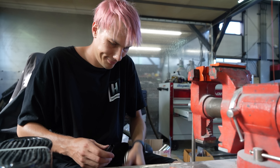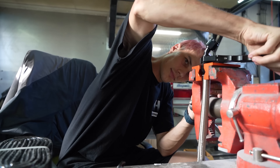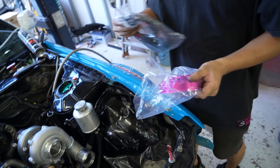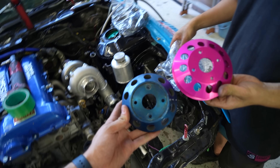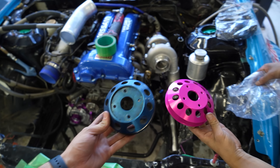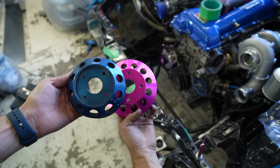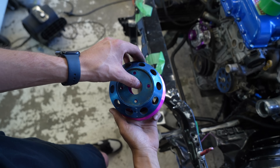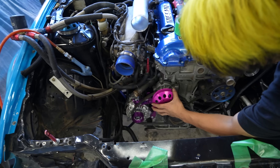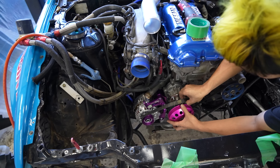Time to go back to Kawai-san's shop. It's time to switch out this small pulley for the Yashio Factory one. Just look at that comparison — massive difference. This one is smaller than stock. I have no idea why you'd want to overdrive the water pump on these. The Yashio Factory one is much bigger — a decent size bigger. That's going to help keep this thing cool and pump more water around at high RPMs. You can also use the stock belt size; it's really tight so you just have to work with it a bit.